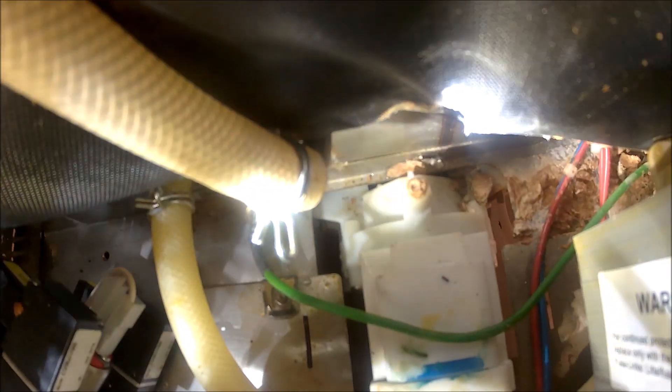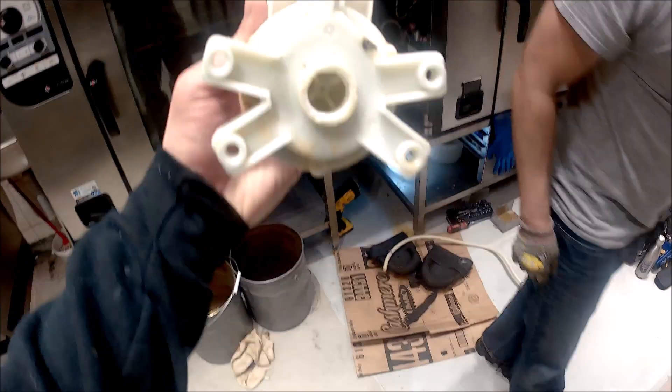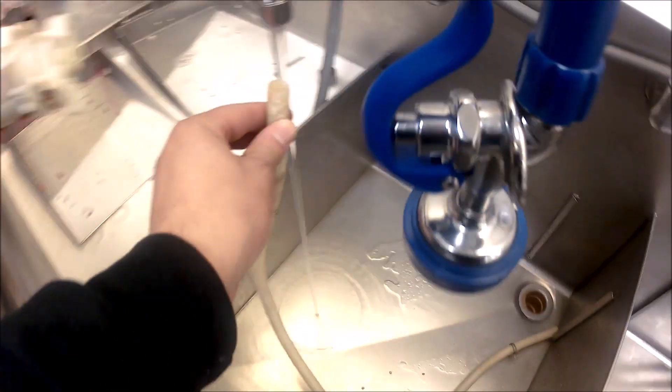We got the tubing off and took a peek inside the pump — you can see it's plugged with grease in there. I checked that water manifold quickly at the top and it does not have grease in it, so we're going to get this pump cleaned out. You can see it's completely plugged. Make sure you don't get the electrical components wet when you're cleaning this out. Our tubing is very clear — there's nothing stuck in the tubing, which is a good sign. We're going to reassemble everything.